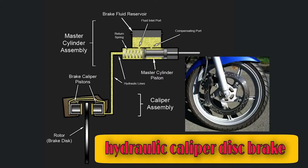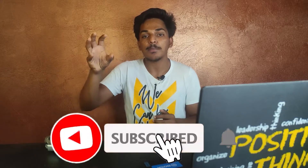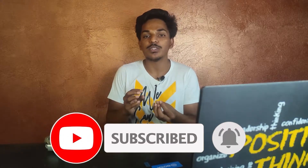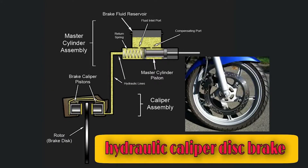If our bike is in a moving condition, this is the wheel here. When the brake is applied, you will be able to move the piston. The pressurized fluid goes through the brake hose pipe and goes to the calipers. The pressurized fluid then moves the caliper piston, which pushes the rotor on the inside brake pad.